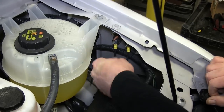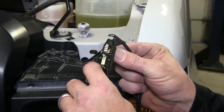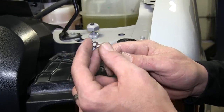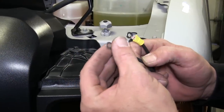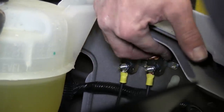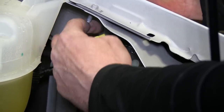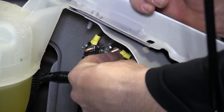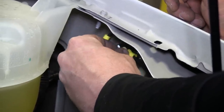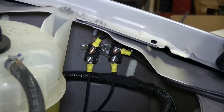Now with the power wire secured, we're ready to go ahead and create our hot leads. We'll take the wire remaining from our gray duplex cable, add ring terminals to two ends, and then secure the large ring terminals to our two hot leads. Once we install the star washer and nut securing all our wires to the breakers, we'll go ahead and tighten them down.